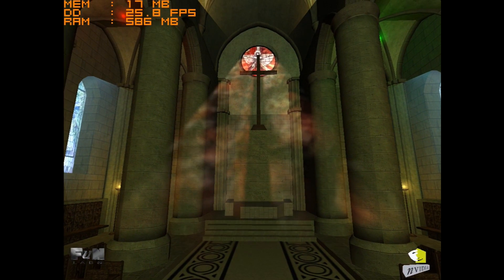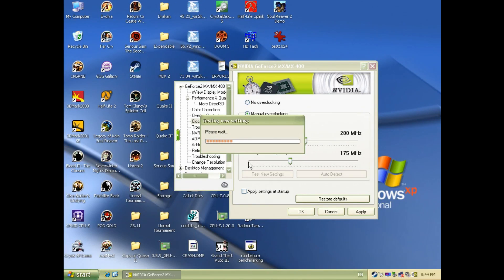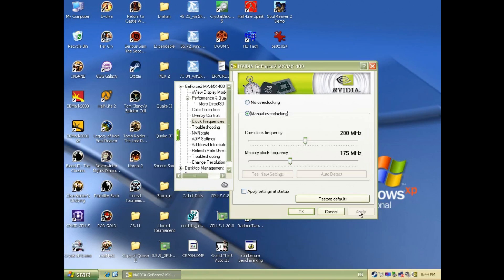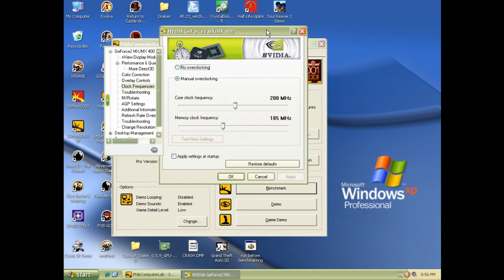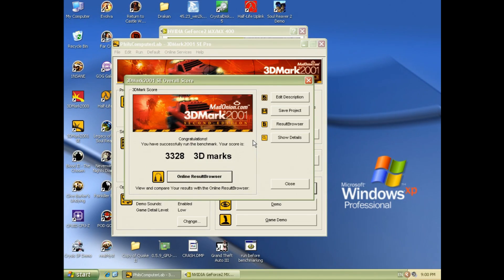Let's talk about overclocking. I used the Nvidia driver to overclock the core. The core is based on the same one as the GeForce 2 GTS, which runs at 200 MHz, so you can just put 200 MHz in there and you're basically guaranteed it will work. I overclocked it a little bit higher to 220 MHz. The RAM, however, is where you're going to get the most performance gain — the SDR memory is quite slow. I ended up with a final RAM clock speed of 185 MHz, which gave me stable results; at 190 MHz I would see some glitches in 3DMark. The 3DMark 2001 score improved from 2,919 to 3,328, which is a nice improvement of 14%.